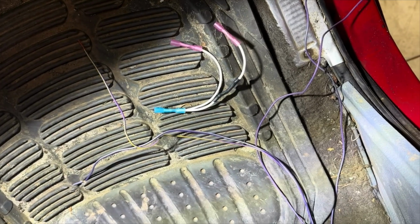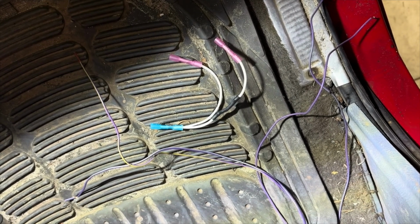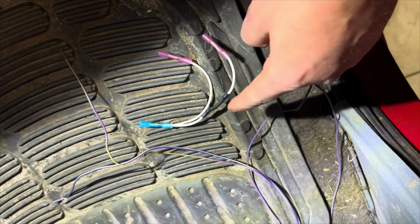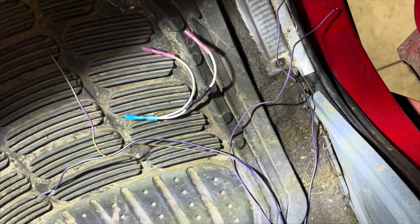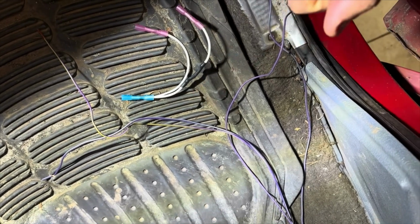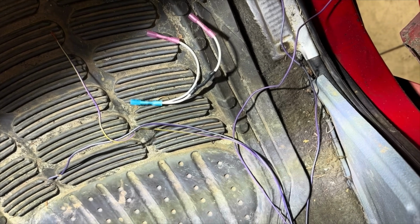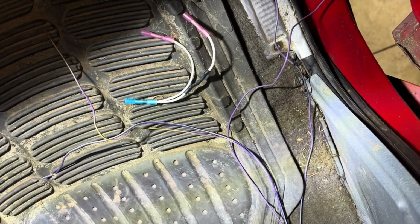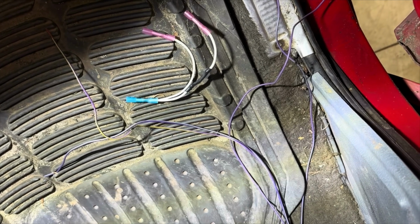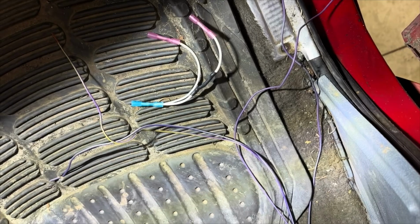Okay, and so we actually include these diode wiring harnesses in the Engineered Vintage amp step mounting bracket kit. So this little wiring harness, it has a little diode. And a diode is essentially like a one-way valve for electricity. So it allows electricity to flow one way, but not the other. And we wire these in to each door so that when you open a given door, both steps don't deploy. If you didn't have this, when you open any door, both steps would deploy on the Suburban. So we're going to go ahead and wire this in.